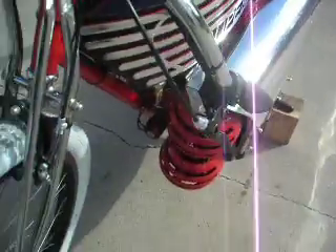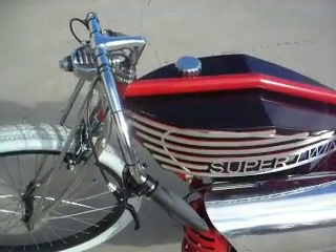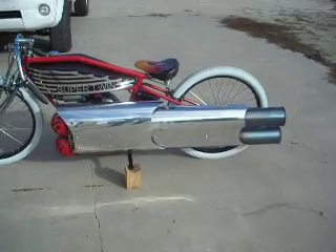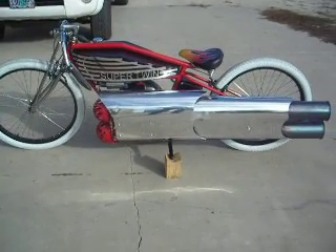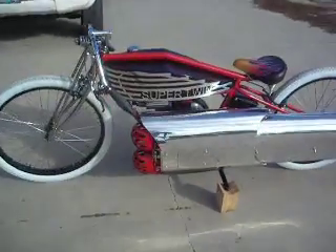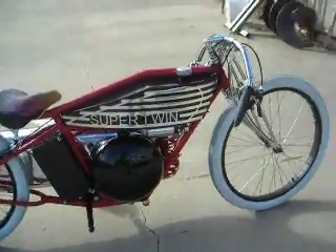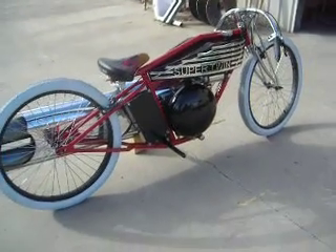You can see on the different videos you can hear the engine jumping from idle to full throttle. The other black super twin was built on a bicycle frame, but this one I made the frame on, and I lengthened it six inches, lowered it two inches, and raked it three and a half inches — and it really made a big difference in its top end handling.